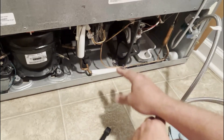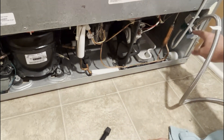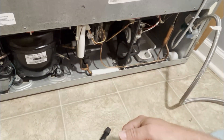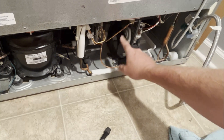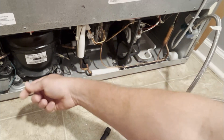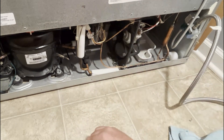Now that we have access to the back of the fridge, you'll see some of the components. Right here is our fill valve with the water lines going to it — it's really easy to access. If you haven't been in this area in a long time, chances are it'll be full of dust. There is a fan in here that blows across the components to keep them cool. It's a good idea to get a shop vac or vacuum cleaner and suck out all the dust bunnies and clean off the fan.